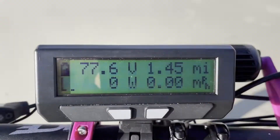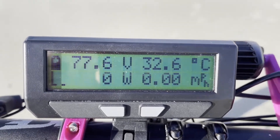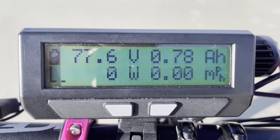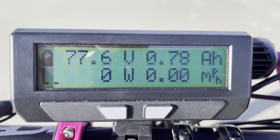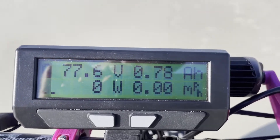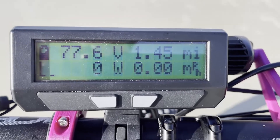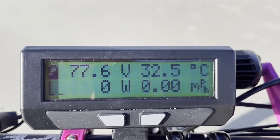So really what this device is is a custom tuning device that allows throttle input to be translated to different outputs. It offers power control, throttle control, pedal assist features, plus a whole slew of data logging features. You can tune the bike, limit power, add power, tune the PAS, monitor temperature, monitor speed, and monitor anything from a shunt — whether it's a low-power or high-power shunt — all at your fingertips, making even a basic controller fully tunable on the fly. If you don't have one of these, you really need to look into it. Don't be thrown off by the display not being pretty — the features it offers far outweigh the aesthetics. It's a really useful tool and I'd love to see more people using it.